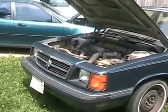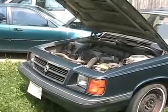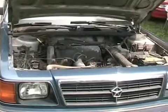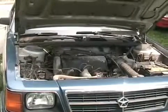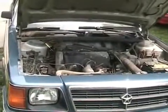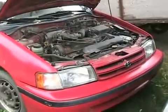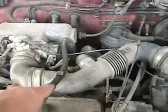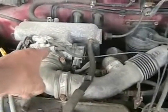So when an engine is running, it's not actually sucking air in, it's just creating a vacuum and air pressure pushes itself in. Well, on a typical engine with no forced air induction system, you can never get quite to 0 psi where air exists at unhindered maximum flow. So if you were to add a supercharger or turbocharger, then somewhere on the intake system you would have a supercharger or turbocharger adding pressurized air to the plenum.